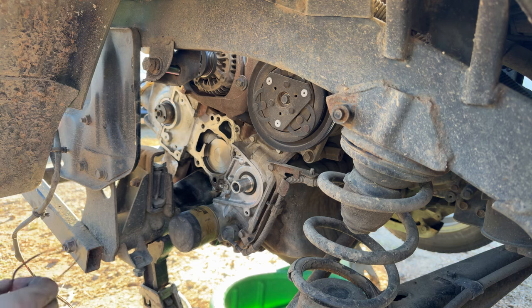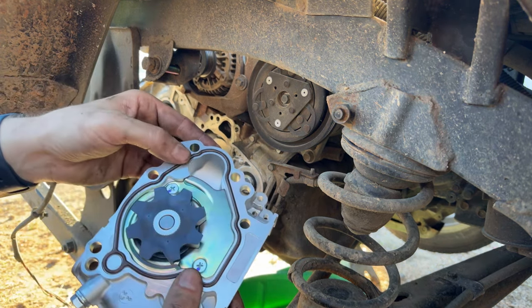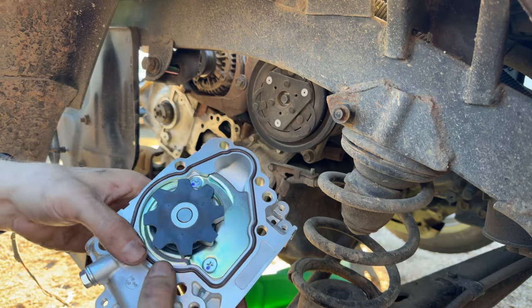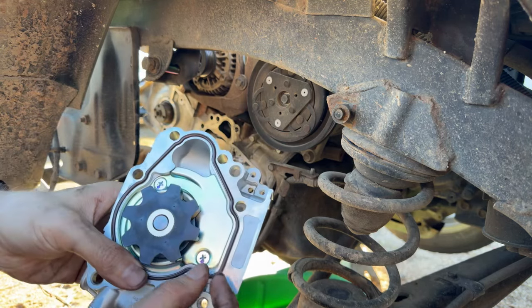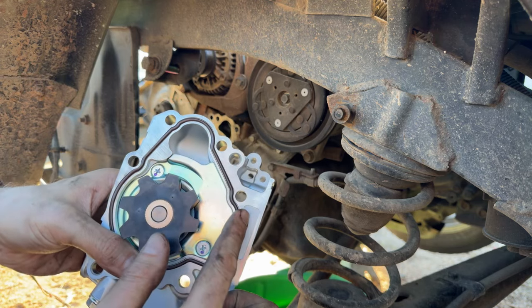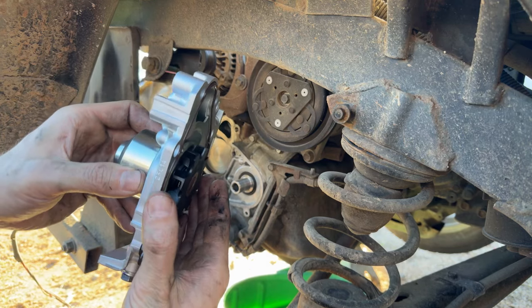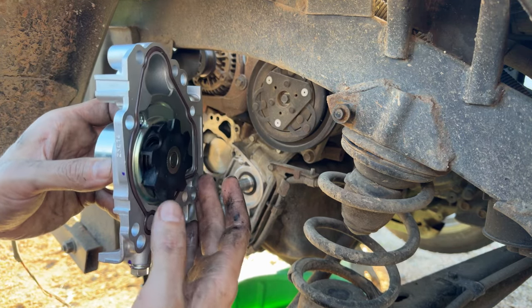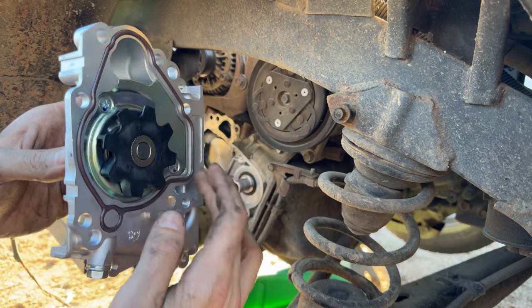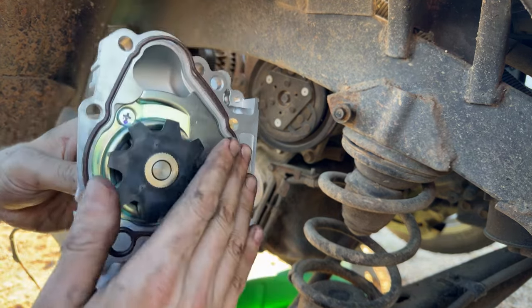This is the worst part, I swear, about this: these gaskets are so finicky about falling out of this groove. I don't know why they didn't put a little peening sometimes in these that will grip onto these little molded gaskets. If you get it up here like this and tilt it slightly, it'll come loose, and then you can pinch it over and it won't align correctly, and then you get a leak, if it just doesn't sit perfectly.